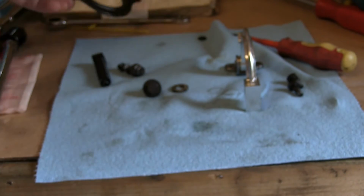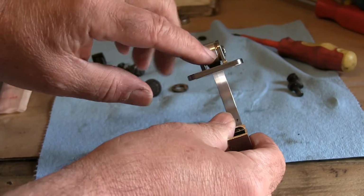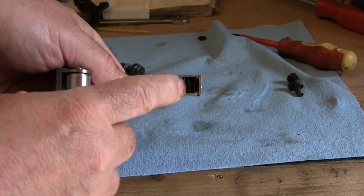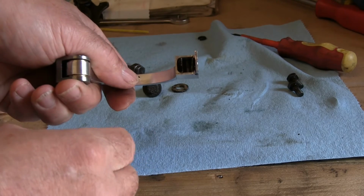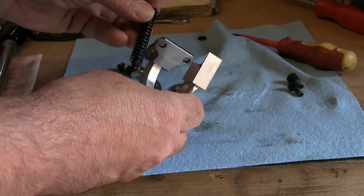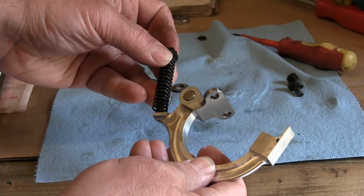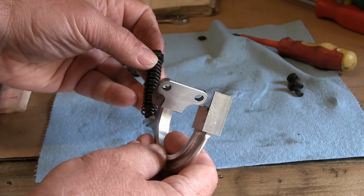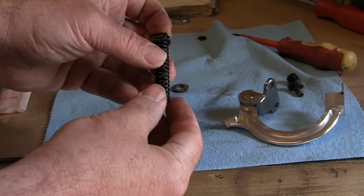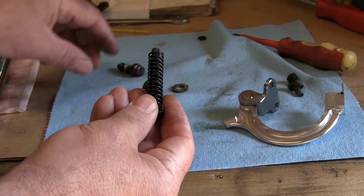So the new one, which is supplied by David Silver Spares, has got some brass bushes in it, so that moves really freely. There's a follower here where the blade needs to go in, that's been pressed into place. Took the old one out, and how it effectively works is this plunger comes down and pushes that round on the bike, and that effectively tensions the chain. It needs to be done while the engine's running, and what happens is this little thing here, it'll be in that way around into the block.